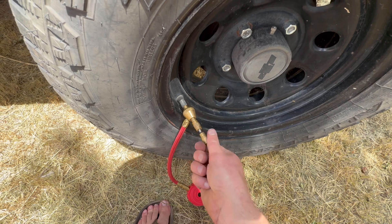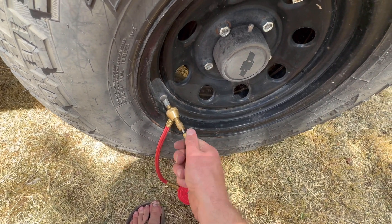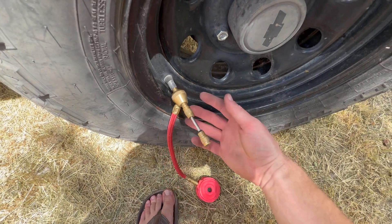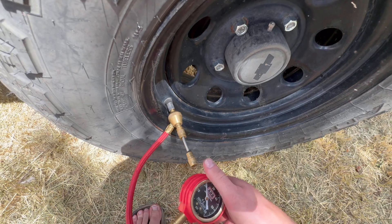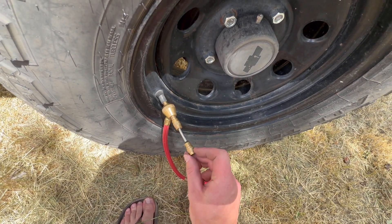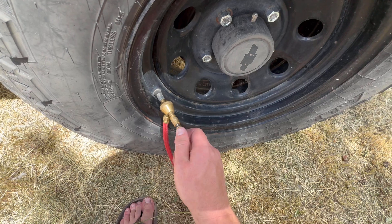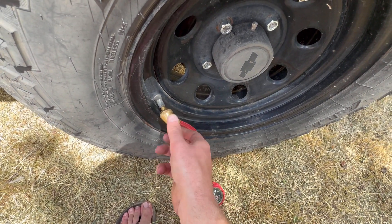Now take this, spin it out, and you'll know when you're done. You've got to maintain a little positive pressure while you're doing this. Start spinning it, and right now we should see on the gauge our tire pressure. If we pull this, it releases air pressure. Once you have it down to the air pressure you want by pulling this, check where you're at. Then you can take this, push it back in — you've got to put some positive pressure in — push it back in, twist clockwise. That closes your valve core; you're locked in. Now take the middle section and unscrew it.